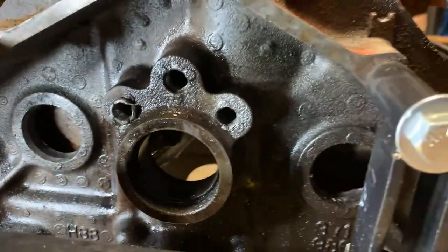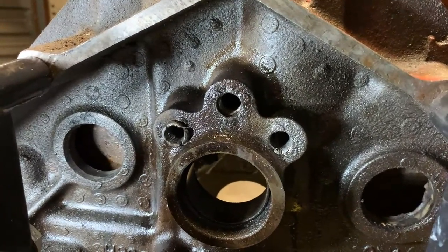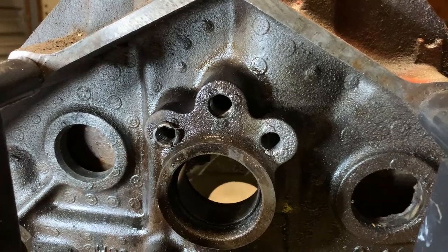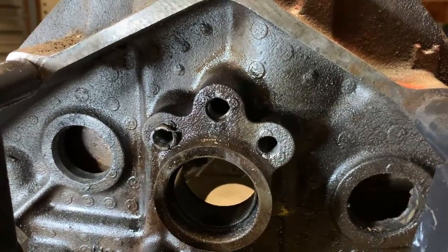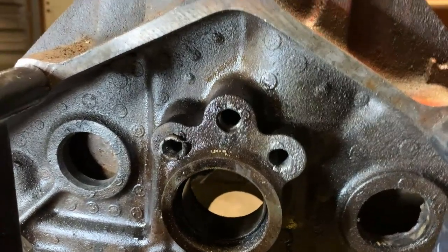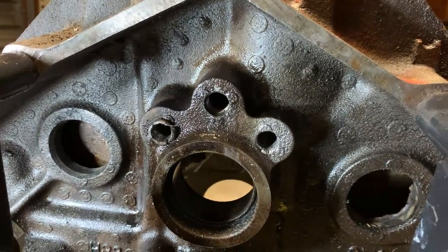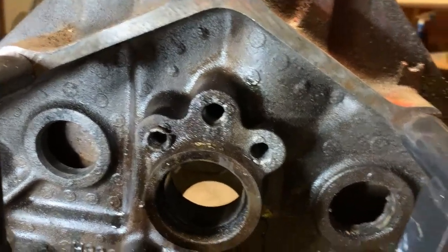Removing the threaded oil galley plugs has turned out to be pretty difficult. I've tried many different things, from using a 3/8 to a 1/4 inch adapter, to trying to drill out the plugs and tap the plug, put a bolt in there, trying to get it out, heating them, trying to drill them out completely, and using an easy out that didn't work. So the only thing that I've had to resort to was drilling them out completely, almost down to where I was touching the threads,